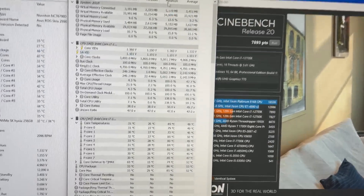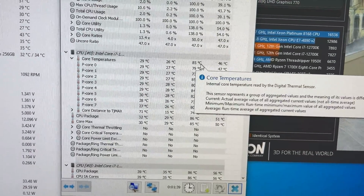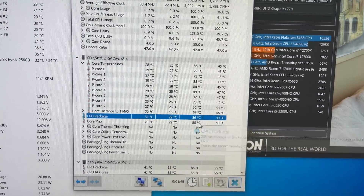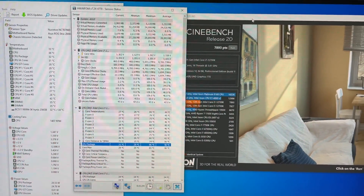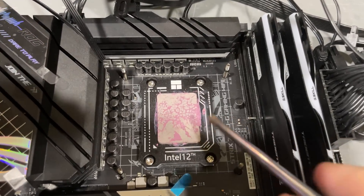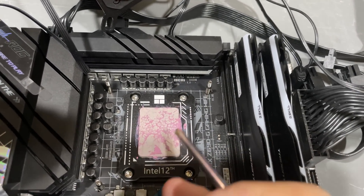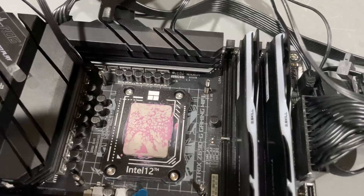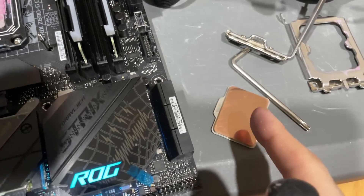Keep in mind my CPU is delidded, so I don't know how it would be on a stock CPU — maybe we'll have to try that after. The hottest core here: 84, 85. So 1 degree Celsius on the hottest two cores, and then a couple of other cores dropped by 2 Celsius. So maximum power, 86. I guess we can say 1 to 2 degrees Celsius here. So it kind of seems to be about the same — instead of it going vertical it's kind of going horizontal a little bit here. It's kind of hard to pull it up without moving the paste around, so take that with a grain of salt. But if this IHS does have a groove in it, then a freshly lapped one should solve that problem.